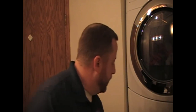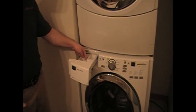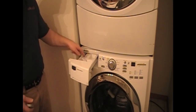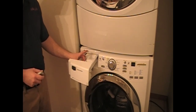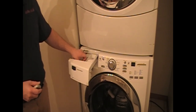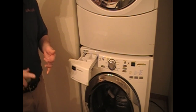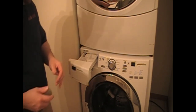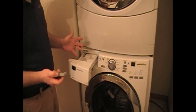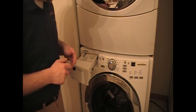So how do we get rid of the liquid soap residual? We're going to go to the dispenser. Inside the dispenser on some machines, there's a divider or indicator that tells you to change something to put powder detergent in there. Some washers have a little cup for liquid — do not put powder in that little cup. Check your instruction manual or the manufacturer's website. We want this powder detergent to flow freely in the dispenser, so remove any obstructions.